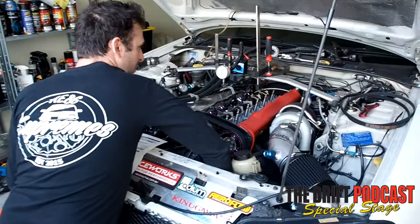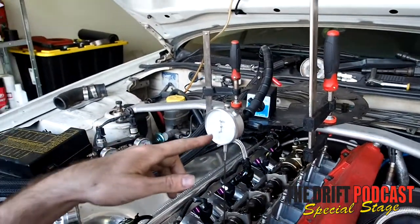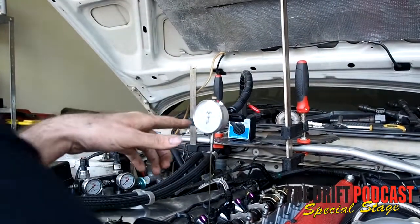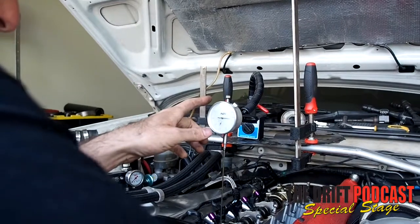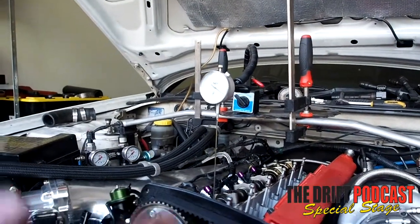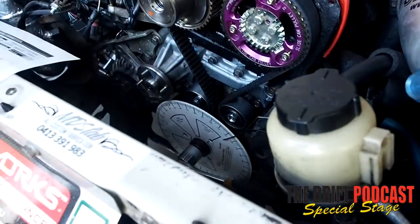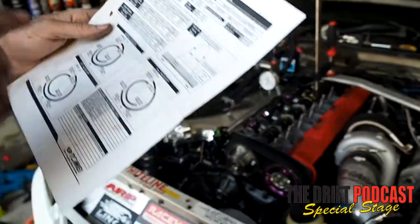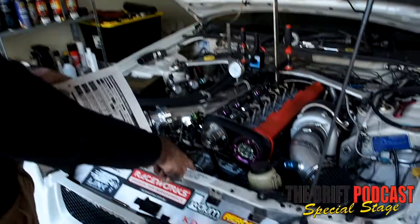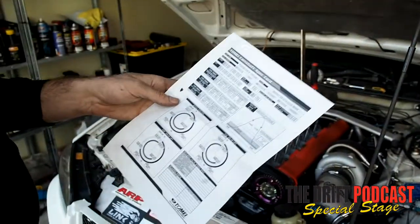Now we'll watch this — it was sitting between 4 and 5 on the large scale of the dial indicator. We spin it around, it's now at maximum lift. We get it back around and wait for it to start going the opposite direction as it winds itself back. We keep tapping to get close. That is now at 1mm the other direction. This is showing that we're at 124 degrees. If we look at the cam sheet, it will say 54 degrees for intake cam closing. Don't get confused — you have to go 180 degrees minus 124, that's 56. So we're again 2 degrees out on our intake cam close. Adjust it, check it, check it again, and then probably check it again.